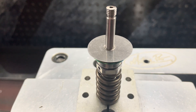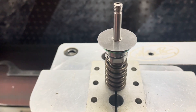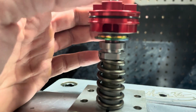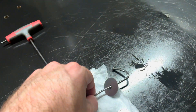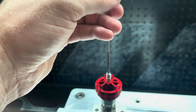All the shims are on straight — none of these are offset to the side or anything. We can put this on, and if we do it right we'll see that the shims will compress a little bit as we push down. That is our shim preload, and that's what we want. Next step is to install the rebound shim stack.